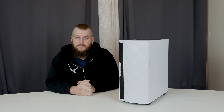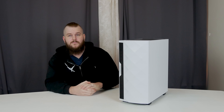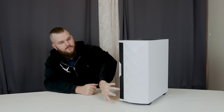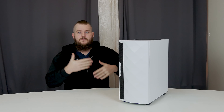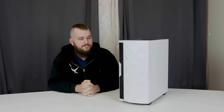This case is pretty much terrible when it comes to airflow. There are a couple of things that could solve it — either removing the side panel or chopping up the mesh front to make bigger holes for air to come through. It didn't even make a difference whether you had no fans in the front or three fans; it just wasn't worth it.